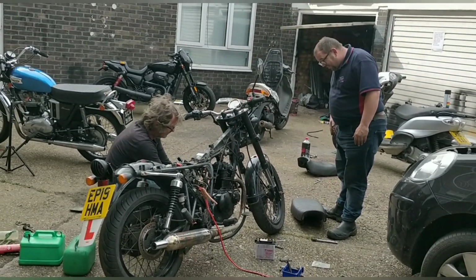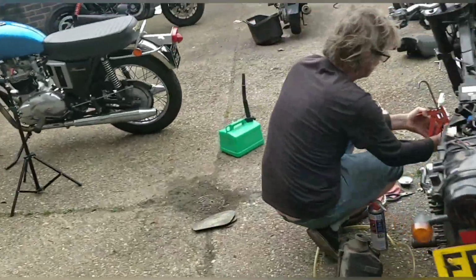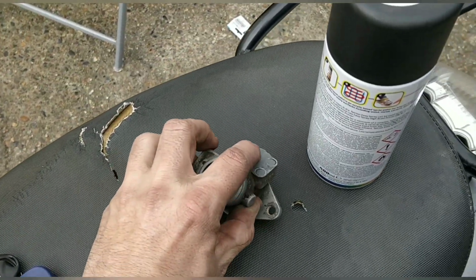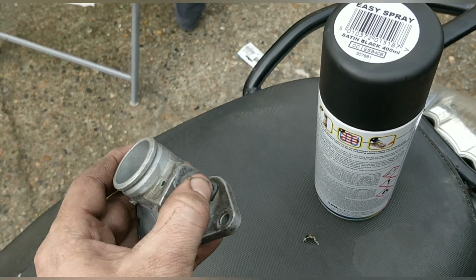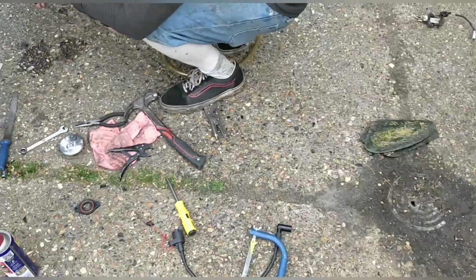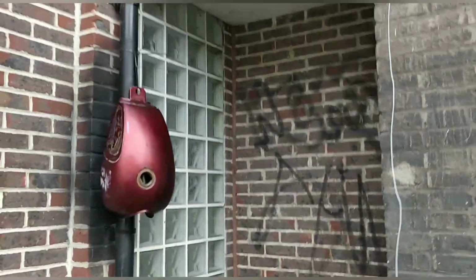Alright guys, still got John and Stuart down here. The fix for the intake is over here. It's a kind of liquid steel. It comes in two parts. You mush it together and it turns rock solid, metal-like, and actually it is rock solid, smooth on the inside. That's spot on. What you can do is put tape around it if you're really worried. We're also thinking about exhaust options on that bike because it will be good. But let's start looking at some paint.